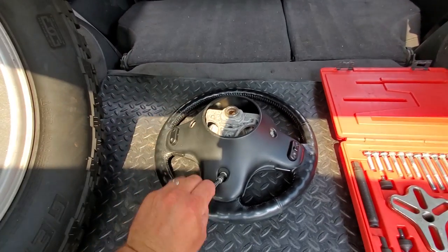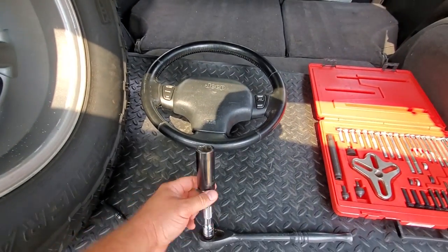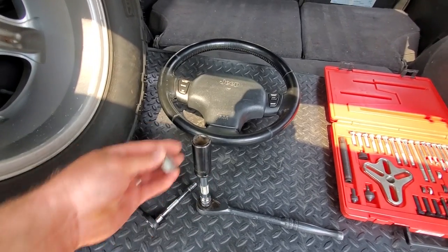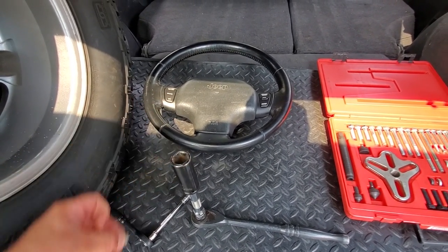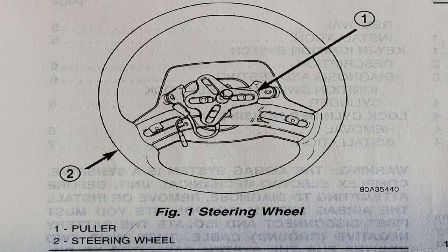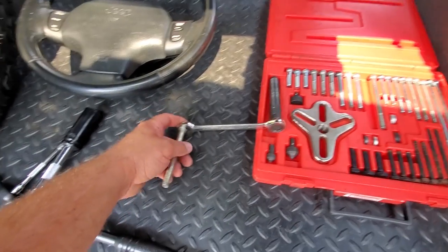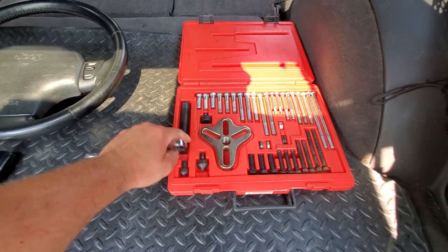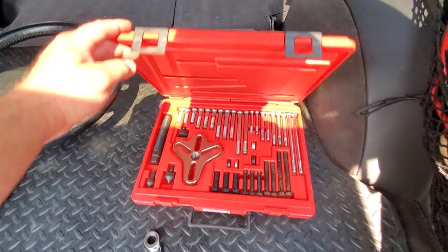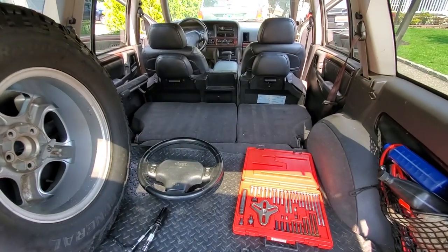And this is 21 millimeter — all pretty standard for the steering column nuts. Then what you're going to need is a puller and a tool to operate the puller. This one is 14 millimeter, and the screws I use to pull are also 14 millimeter. So 14 millimeter all around for me. Now this is a Snap-on puller but you can use any puller — I've gotten a good one on Amazon, I'll leave a link in the description below. This is actually Andy's — thanks buddy. The battery should be all dissipated now, let's go ahead and take that bad boy apart.